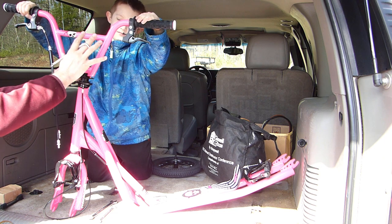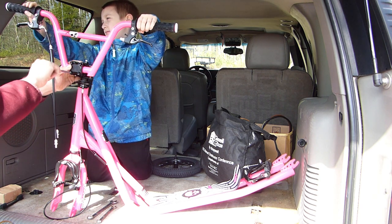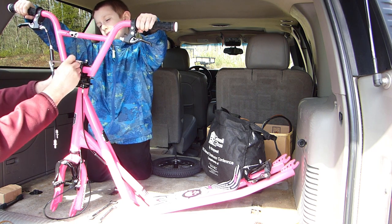I've got the angle of the handlebars adjusted for the person that's going to be riding this scooter most often, and now I'm going to tighten up these bolts. I'm going to start in one corner and then work my way corner to corner and tighten everything evenly.